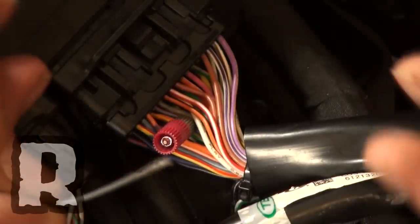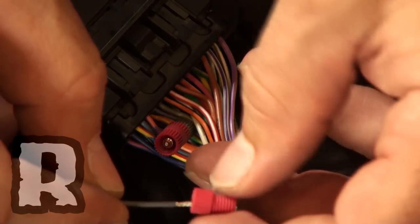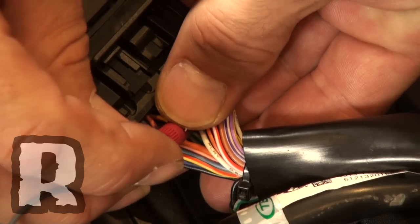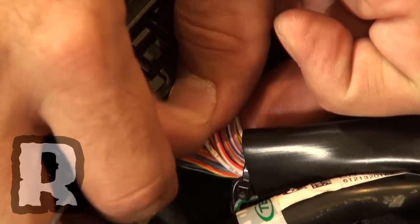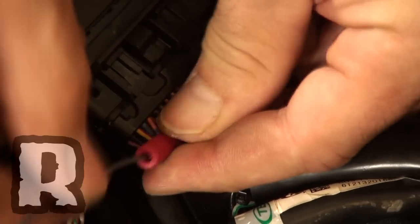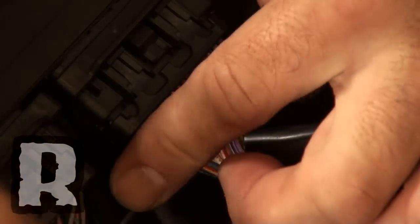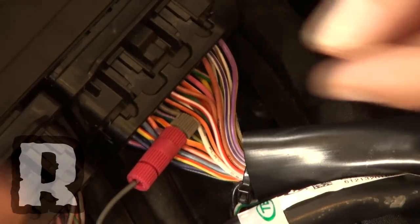With the other end, you're going to attach this gray wire that they supply into the back end of the other pink end of it. You basically reassemble this — push it in while you're doing it — and this will wrap the wire around the other two, joining them. This is how the Power Commander taps into your throttle position. This will tuck away quite nicely right underneath there, and you may want to run the wire underneath some of the other wires down here.